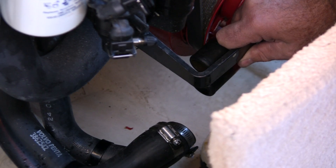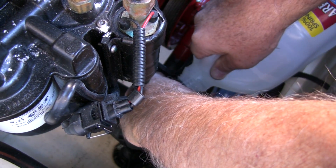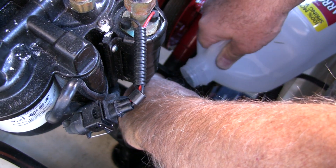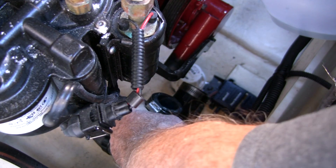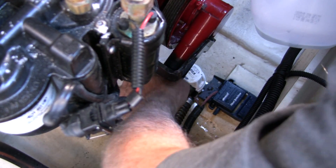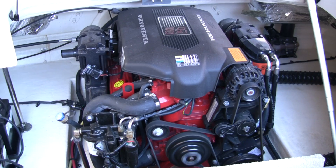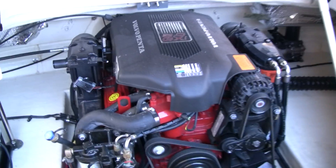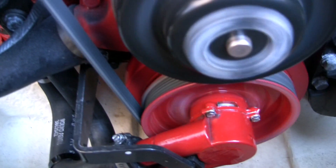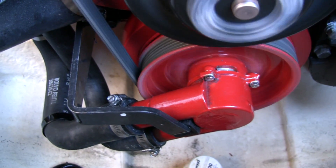Finally, to aid the pump in its startup, add a few ounces of soapy water to each of the hoses, and then install the hoses. The installation is all complete, so we can start and run the motor and check for leaks. This motor has been running for about 10 minutes and it looks like we've had a successful repair — there are no leaks.